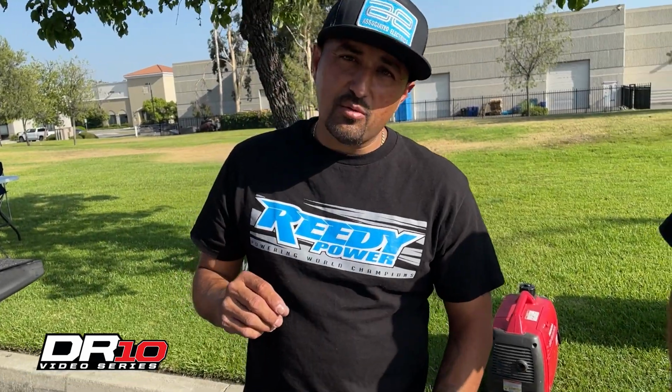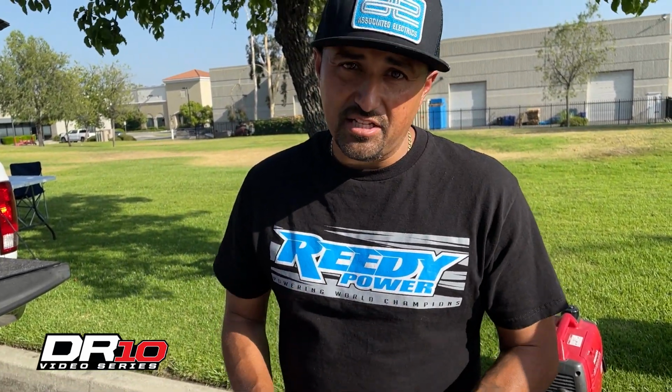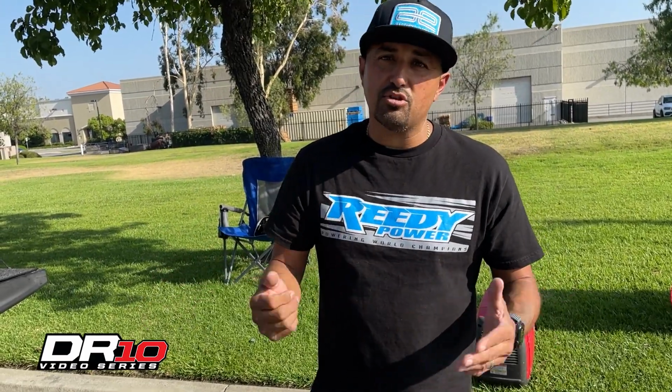One crucial tip you're going to want to pay attention to when drag racing is slowing down the steering. One thing with steering on drag race cars, the faster you go, and as fast as your steering is when it's stock out of the box, it's a little too fast and you can lose control of the car and flip it over. So by slowing the steering down, any little adjustment you make at the top end and the high speeds, the car is going to respond nice and smooth versus really jerky and you lose control of the car.